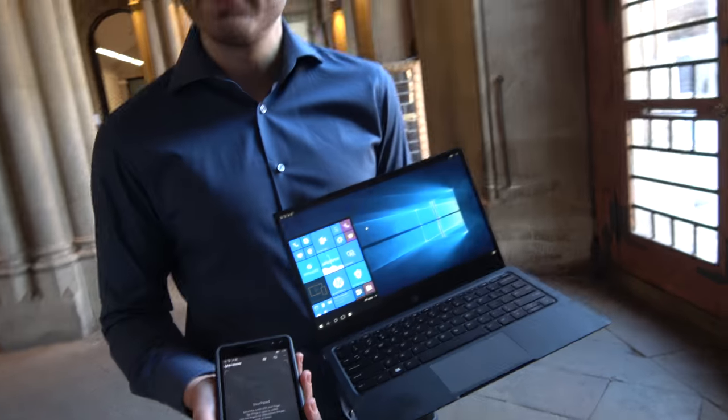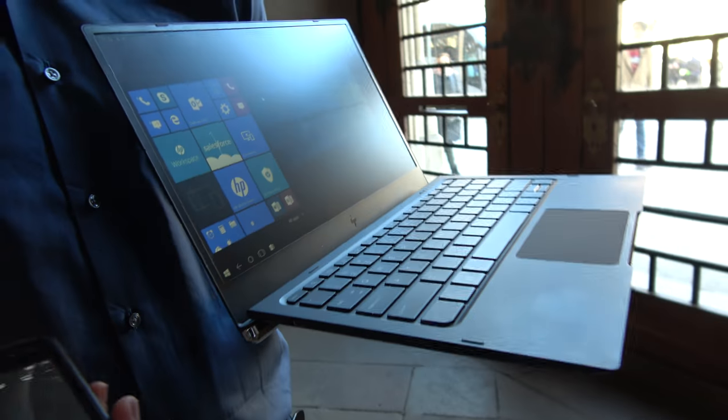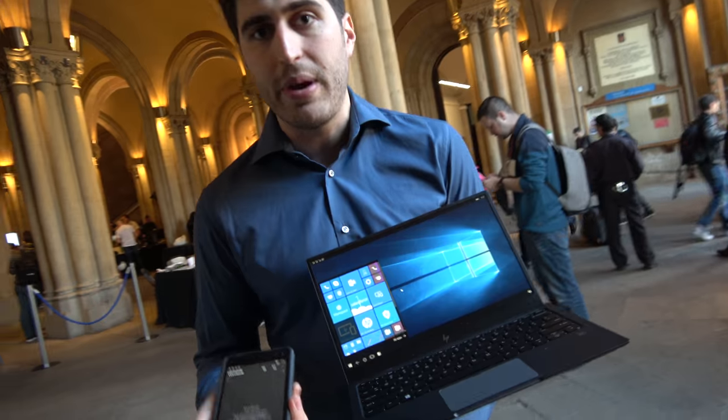So what is the technology for the connection? Is it DisplayLink or how does it work? No, we don't want to have any drivers installed, so we are actually using native USB-C alt mode technology, meaning that when you're connecting USB-C to USB-C, it will use the alt mode technology. When you're using the wireless technology, it's going to be via Miracast.